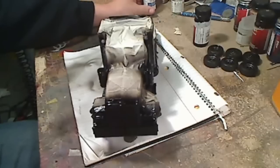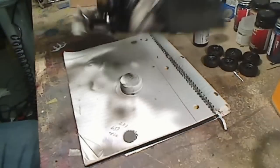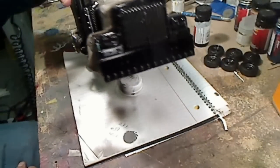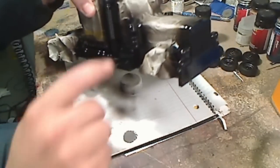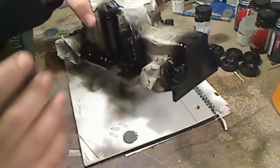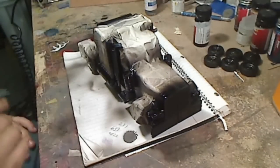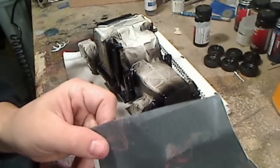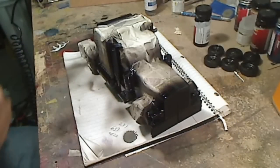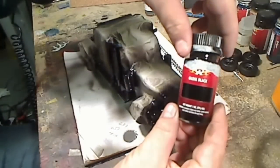The most important thing to doing this is your base coat of black. You'll notice here — this is the prime that I had in a couple earlier videos this week. All the body work is painted off and now I've taped off everything, exposing only the parts that I want to chrome out. In order to get a perfectly smooth surface, I've used 1200 grit sandpaper made by Gator Grit. It's a wet sand, and then I've also buffed it and used a lacquer-based gloss black paint.